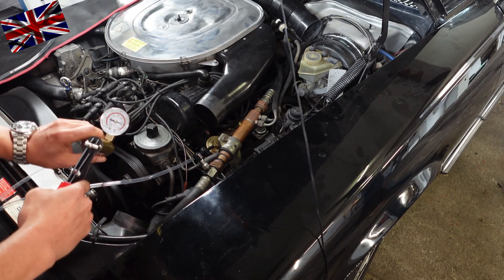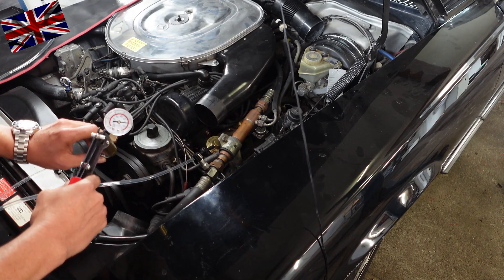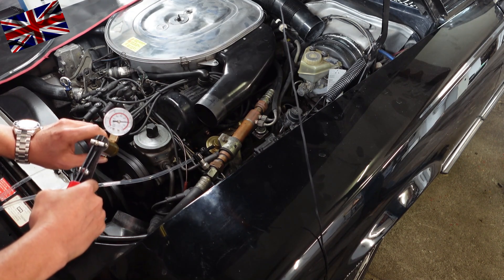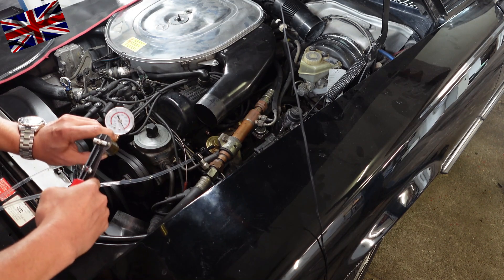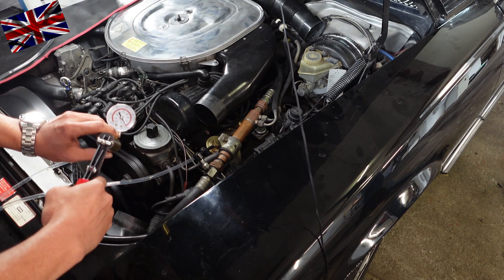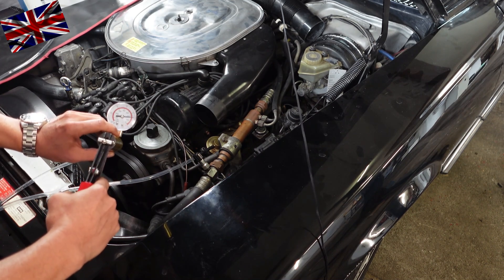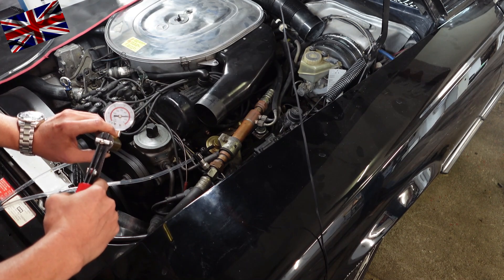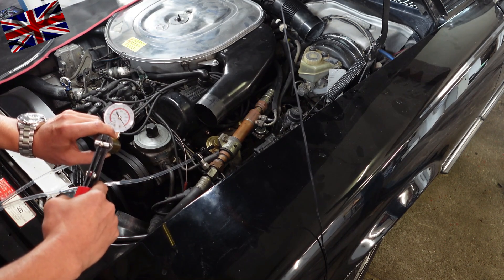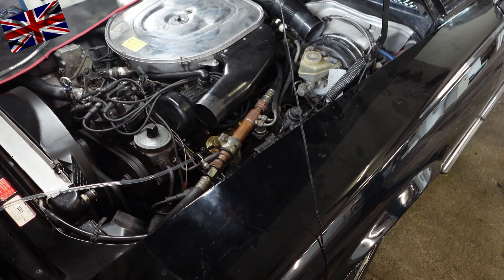Notice I was alternating vacuum to make the plunger open and close. I made the plunger open, allowing burnt gases from the manifold to the throttle plate, entering the combustion chamber without oxygen to burn the fuel. The engine was almost stalling with rough idle at constant revs — therefore this component is working nicely. Otherwise, unbolt and clean.